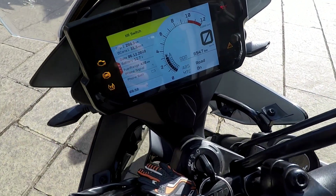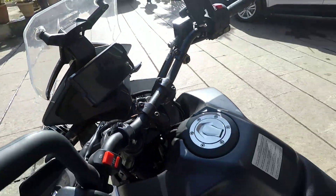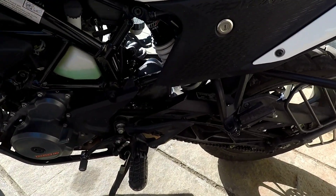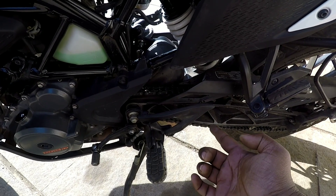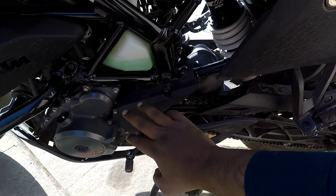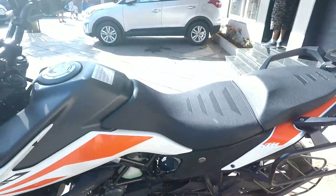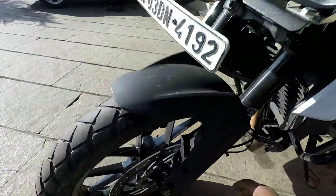The latest issue was with my chain after my Bangalore ride — I had covered over 8,500 kilometers. After Bangalore, there was a problem with my chain; it was running out. So I bought a new chain and also bought a new 14-tooth sprocket from KTM, instead of the original 15-tooth. I also changed the disk pads at the same time.